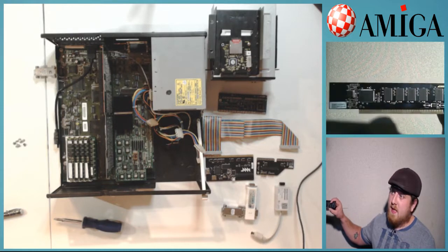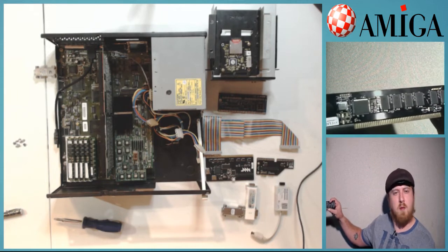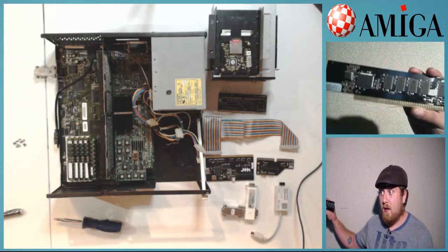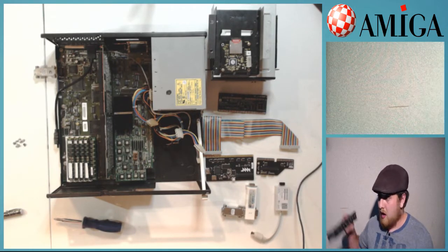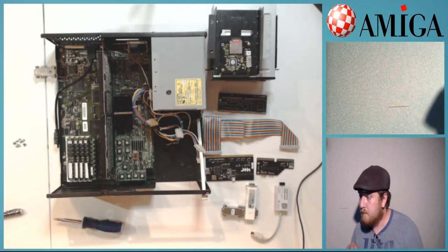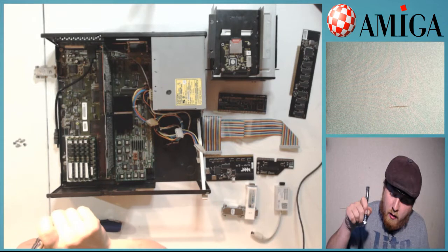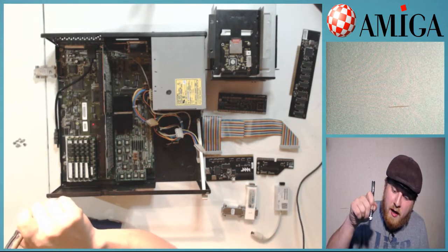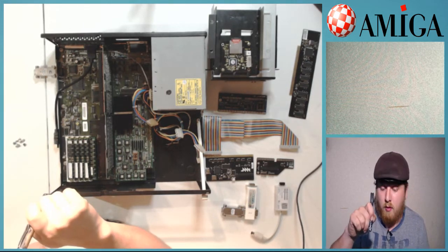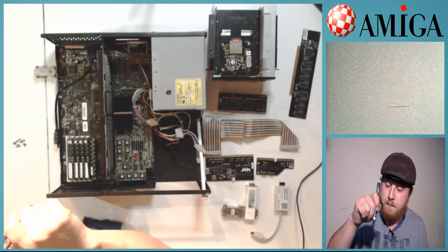The catch is you're wondering, how the heck do you get 256 megs of RAM on an Amiga machine? Well, the biggest thing that you need is, for one, again, a Zorro 3 memory card. So you need a Zorro 3 machine, so an Amiga 3000 or 4000. Two, right here, you need to have a Buster 11. So that's a requirement for the big RAM, the 256 Zorro 3 big RAM.